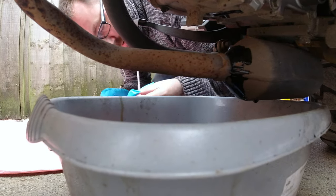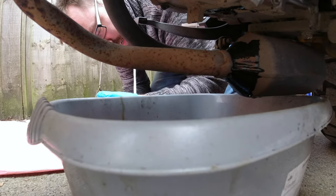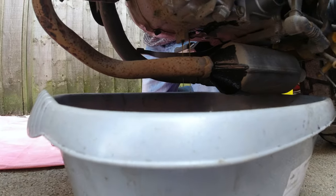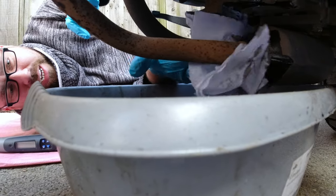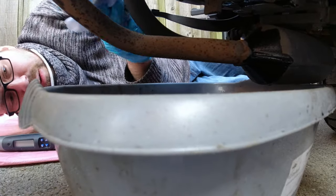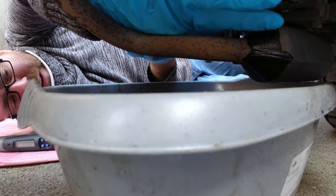We're going to level the bike up by standing it upright, because it's on its side stand and doesn't have a centre stand, just to get that last little bit out. Try to get the excess oil cleaned off as best you can because you don't want all that smoke burning. Don't worry about it too much because it will burn off when the engine gets nice and hot.